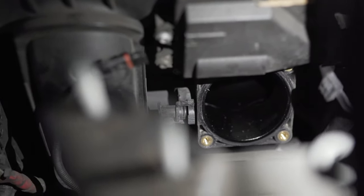Now we're going to remove the crankcase ventilation valve hose. I have this pick tool right here. There is one tab, and 180 degrees away is the bottom one, so I'm just gonna push the bottom one first so the hose moves. Then hold it in place creating a little bit of tension, push the top one, and it's out. That's it.